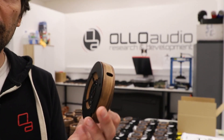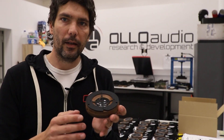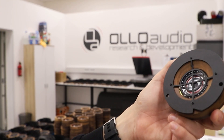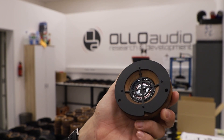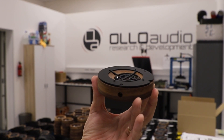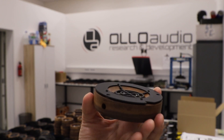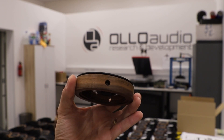Let's explore the ear caps. This is the S5 ear cap — it's slightly different. The flow resistor was modified. The speaker looks the same but it's actually 50 ohm, not 40 ohm anymore. It's also mounted at an angle — not flush as it was before — which helps with soundstage and also with comfort, giving an extra two millimeters for your ears, which is quite significant in terms of human proportions.